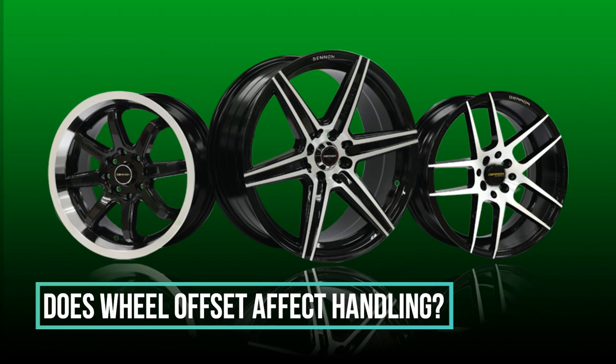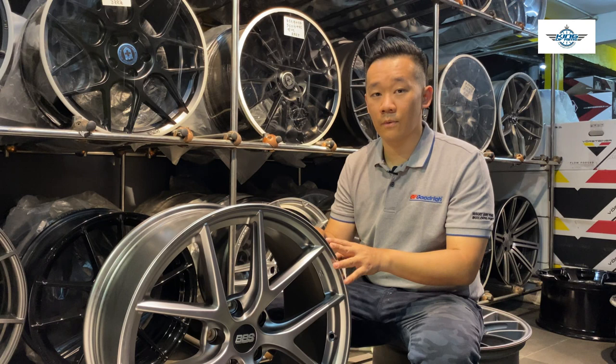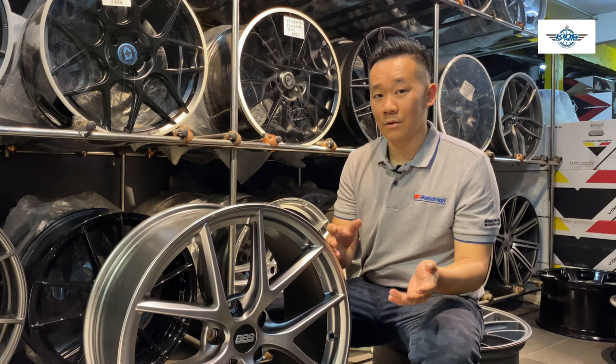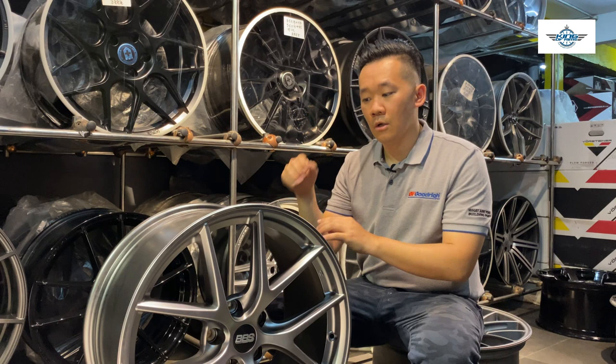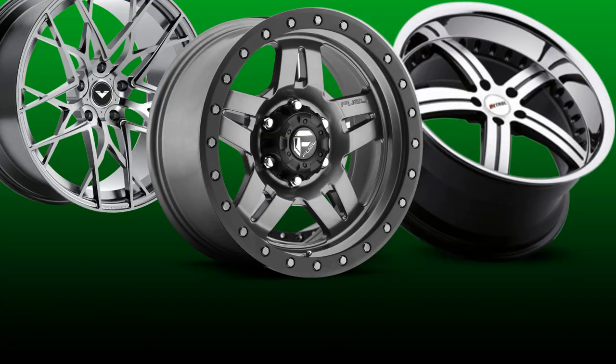When the rims you choose exit the car body, every time you go through a road bump, the tyres and rims will hit the car fender — so you want to prevent this from happening. On the other hand, if you choose a rim which is too inside the car, it won't look nice, and there's a chance of hitting the absorber inside. So what we usually need to do is compare to the original stock offset rims before you make a decision on buying a set of rims.